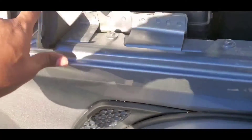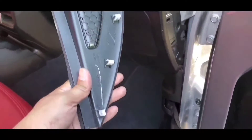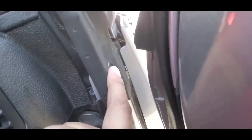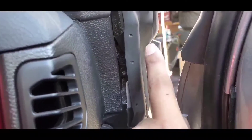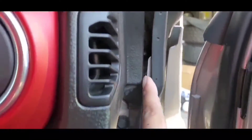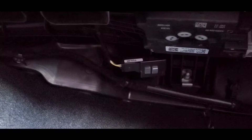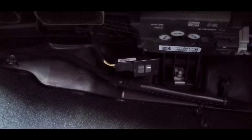I'm guessing we're going to run the wire through here. We've removed this plastic panel that goes on the side — it just pops out. You can see it's got all these clips. I'm going to remove these two little plastic rivets, pop those out, and then that yellow wire is going to come through here, bring it down here, and then tap under the light there. That's a light switch — we're going to tap into that. That's where the yellow is going to go hooked up, and that should activate everything.